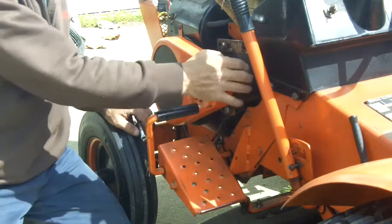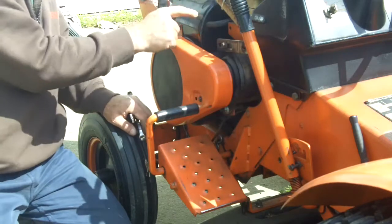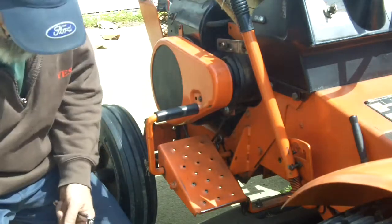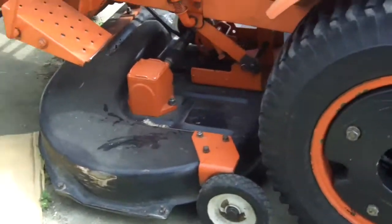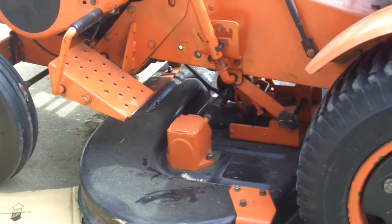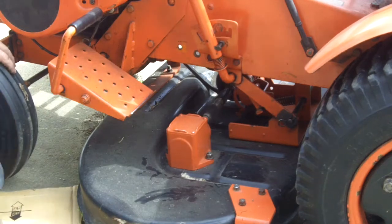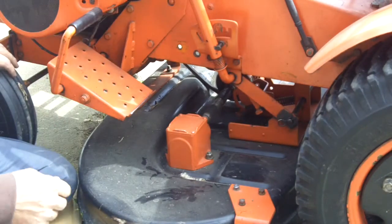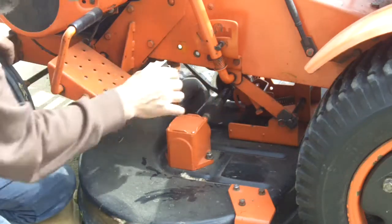As you can imagine, a starter that's made for a Chevrolet V8 engine has no problem turning this thing over. Let's move you over just a little bit. I have to drop the mower deck in order to change this belt — the mower deck is just so much easier with it off because that shaft has to come out.